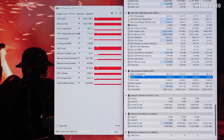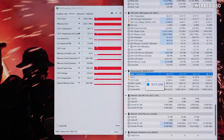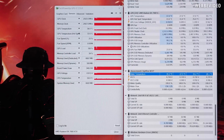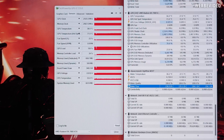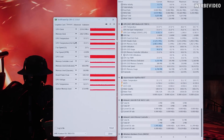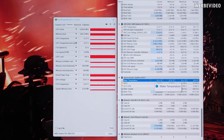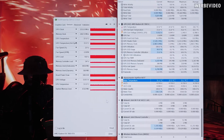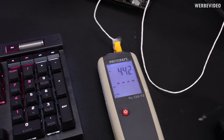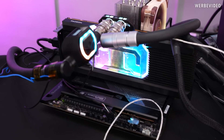It's very convenient that you can find the Aquacomputer flow sensor in HWiNFO without installing anything extra. Water temperature reads about 30 degrees Celsius and water flow is about 158 liters per hour. After half an hour of testing, we have a constant GPU temperature of 37°C, hotspot is consistent at 72°C, and water temperature increased slightly to 31.1°C.